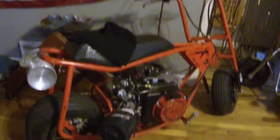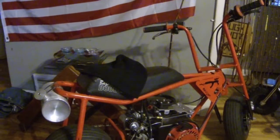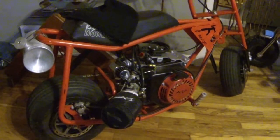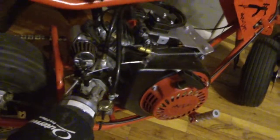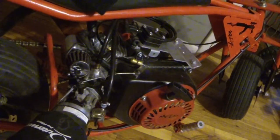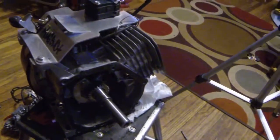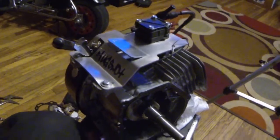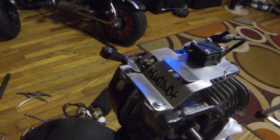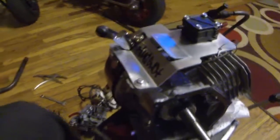Head is just what I had at the time, but it was a clone head, and one of the older clones. I don't even know what version it was, to be honest with you. It's got the 390 carb with adapter. I mean, it's fully built internally also, and on the 1.3 rockers, basically the same setup as this thing, except I guess just the CC of the motor. About the only difference.